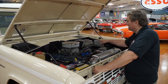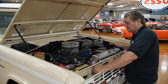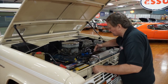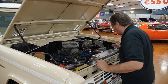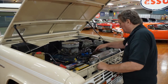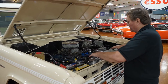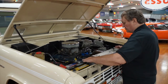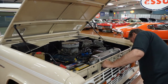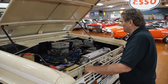It does have power steering and power brakes, and electronic ignition — here's the box for Ford's electronic ignition system. It has a flex fan, probably a seven-blade flex fan, with a radiator shroud to go with this large capacity high-flow — at least a four-pass aluminum radiator. It also has an auxiliary transmission cooler on the front for the transmission fluid.